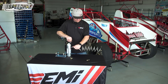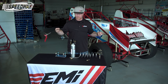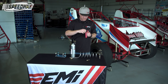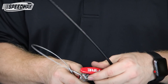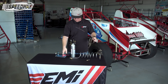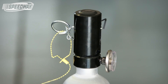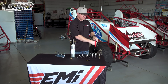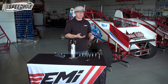So that's the bottle part. Once you get your bottle mounted and your lines ran, all you have to do is set up your release handle. It's just a cable with a safety pin in it — you pull the pin when you're ready, and then you just reach up and pull this handle and it releases all the fire extinguisher chemical. There are two holes in there; you just line that back up for the safety. There's also a safety in the bottle here as well — you don't want to pull that out until you're ready to use it. This cable is adaptable to wherever you want it. You can put it down beside you, on the right side, the left side, or down behind the seat — wherever is easiest and most accessible.